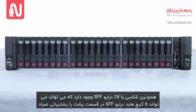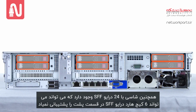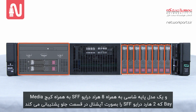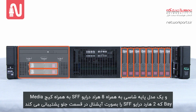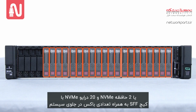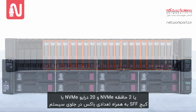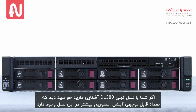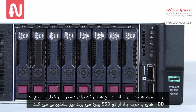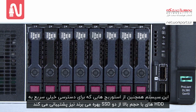There's also a 24-bay SFF drive chassis that can support an optional rear-mounted drive cage with 6 SFF drives, an 8-bay small form-factor drive chassis with a universal media bay that can also support 2 optional front-mounted SFF or 2 non-volatile NVMe drives, and a 20-bay small form-factor NVMe drive chassis with a partial population of box 1 on the front of the system. If you're familiar with the previous generation DL380, then you can see there are significantly more storage options. The system also supports tiered storage, running both SSDs for super fast access and HDDs for high-capacity storage.